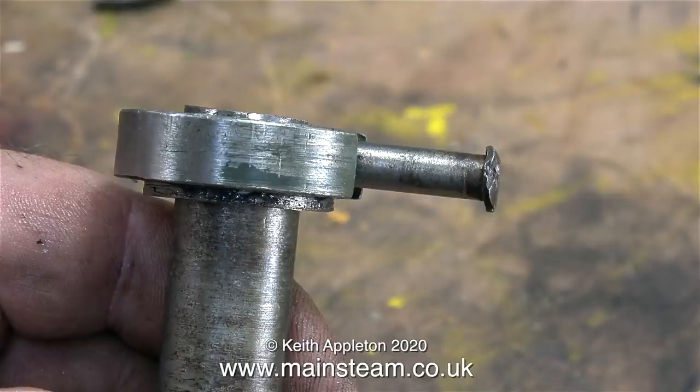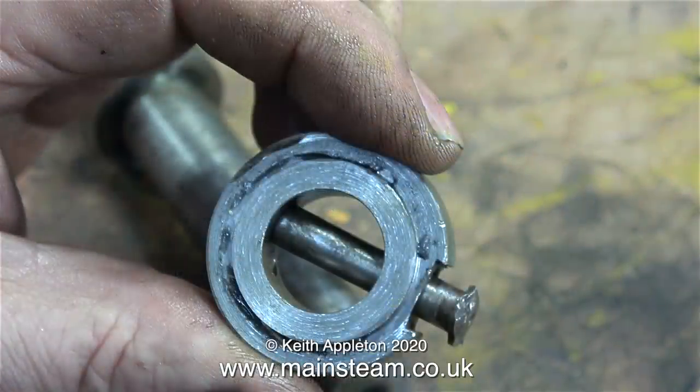Yet the one on the other side was perfect. I wonder what the problem is. The hole in the collar was drilled not through the centre — this is very easy to do. Drilling across collars like this is quite difficult.